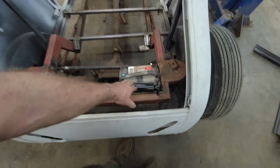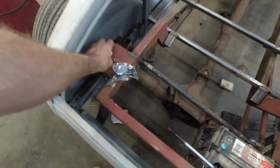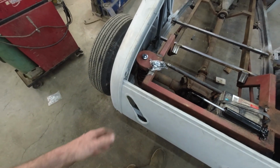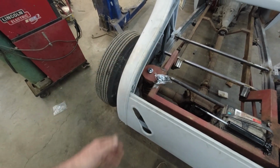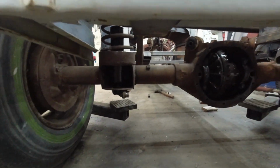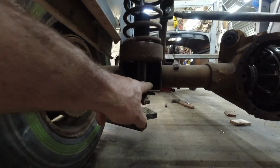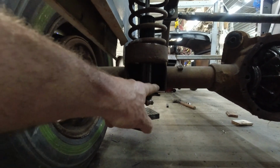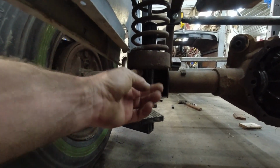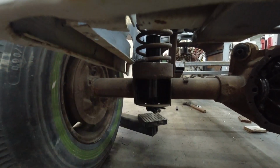All right. Today I got my shocks. They're topped right out. So when you go up on a bump, well, I don't have it bolted on the bottom yet, but there's no actual up travel. I think the way I'm going to fix that is, the way this mount is made up, I'm going to redo this one up here or something so I could actually get some travel out of it. Or even just bolt it to the bottom spring plate. Then that gives you like 3 inches up travel.